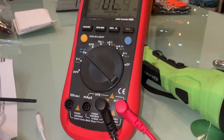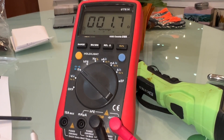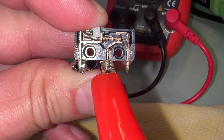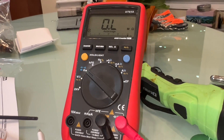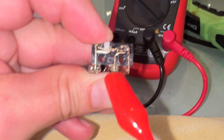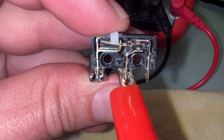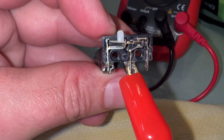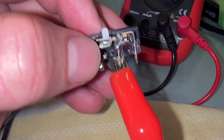I'm pressing on it and it's still going all over the place — it should be zero ohms and steady. Yeah, something is not good with that switch. I don't know if the contacts are already oxidated, but it's not worth looking into anymore. We know what it is, the dishwasher is running, and a dollar eighty-three saved us at least five hundred sixty dollars for a brand new pump, which is what would have been required to fix that F-84 error code.